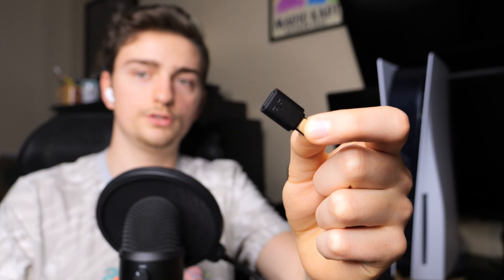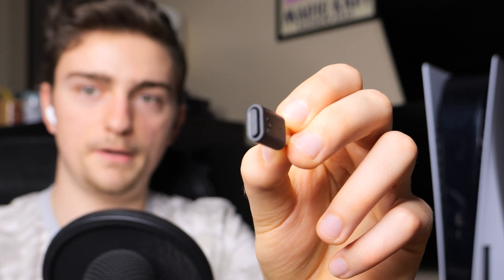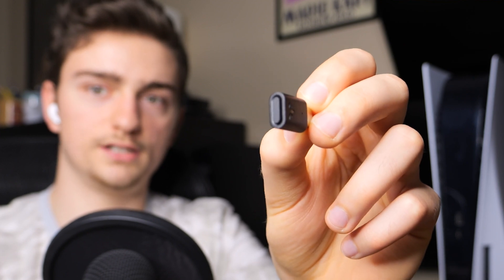When you're looking for your own USB Bluetooth dongle, make sure to get one with a pairing button — you can see that pairing button right there on mine. That pairing button allows us to actually connect the AirPods to the dongle, and the dongle will supply the audio connection to the PlayStation 5. If you see one without a pairing button, that means it is for PCs and laptops, so try to avoid those. Only get one with a pairing button on it.